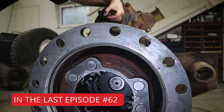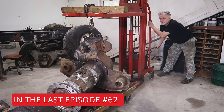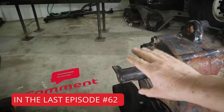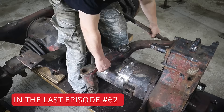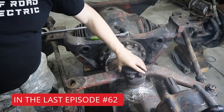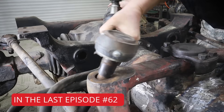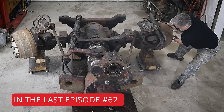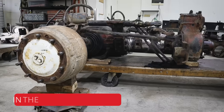And it worked! Next we mounted the entire assembly to the axle. This was very difficult to move because it was very heavy. After we put it together, it worked again — the input shaft moved the wheels. Then we installed the steering mechanism. We connected the links into the steering arm for each wheel, tied up the bearing housing for the steering located on the tube, and added the hydraulic ram which connects the steering with the chassis. Then I tried to steer one wheel and the whole mechanism steered the second wheel too. And after all this hard work, this is what the complete setup looks like.